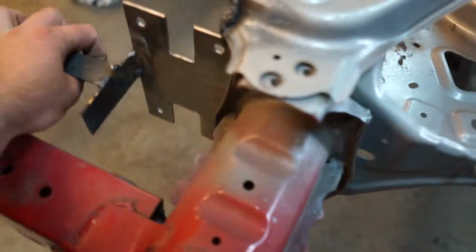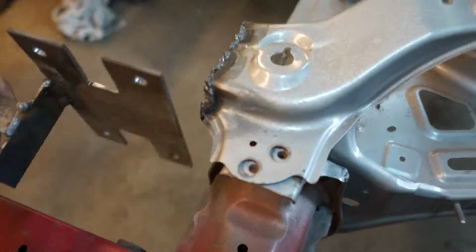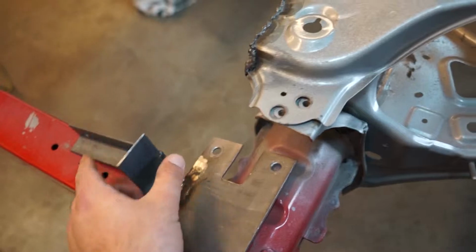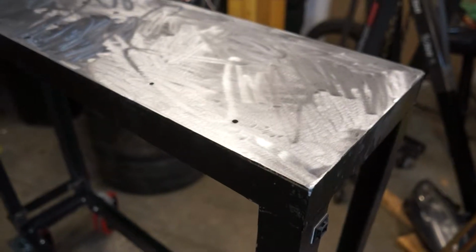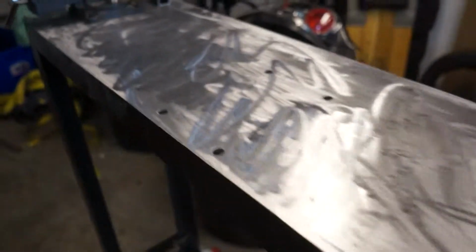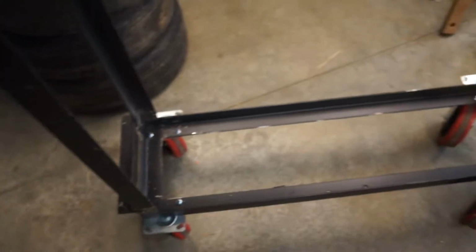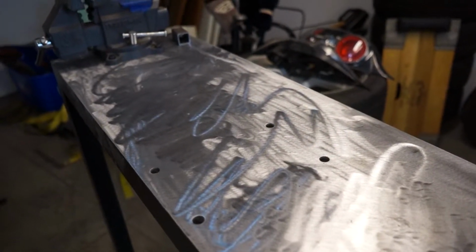So these go inside of where this would bolt on, and then hang out into the middle, and then we're going to triangulate off of here just because this isn't quite strong enough, or we don't want it to fatigue out. This will be the first day using the new fabricating table. This table is made out of some other tables that were scrap at work and some casters, and it's a little tall. It's about 4 feet tall, so it's about rib height for me, which seems like it might actually work out all right. So we're going to try it and see how it goes.